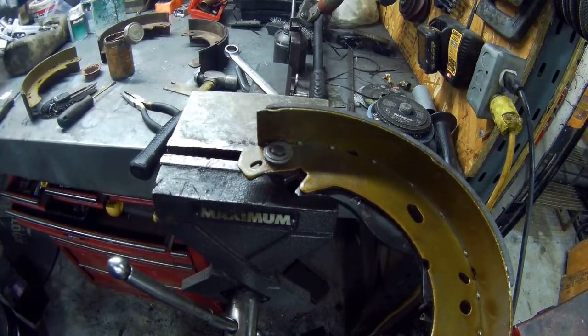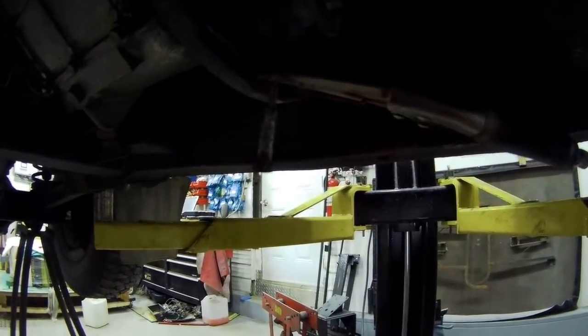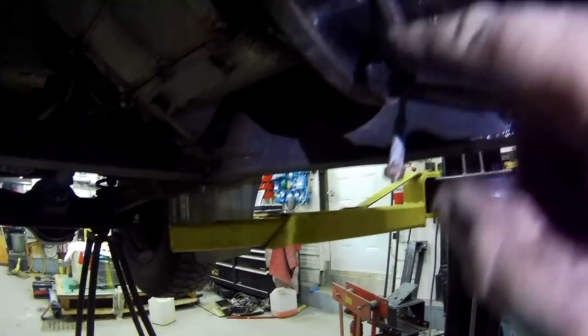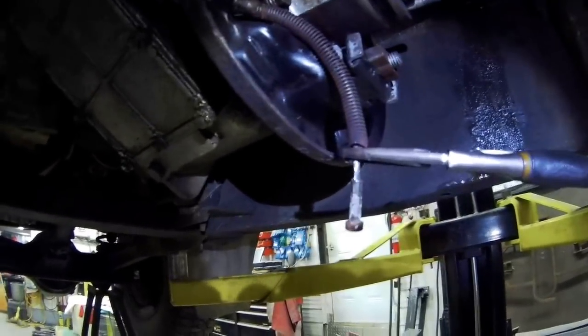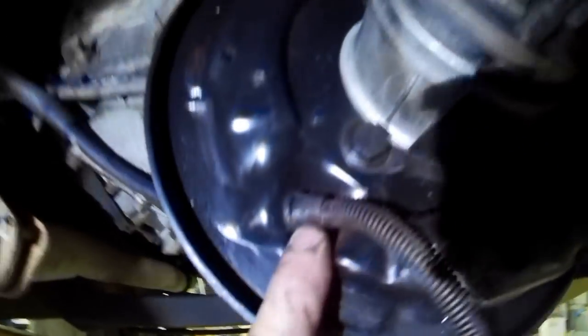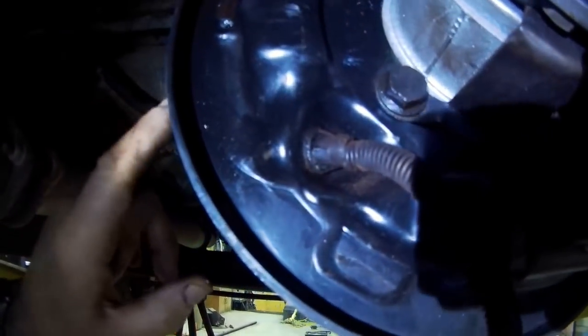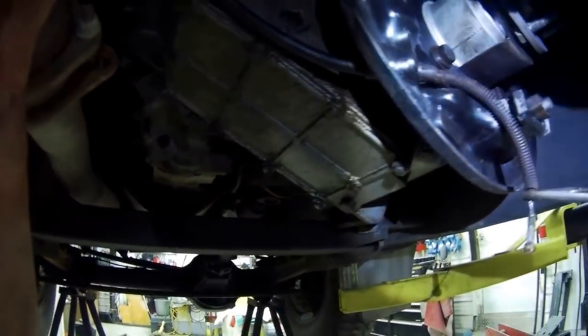Next, we've got to put it all back together again. I actually ran through the videos I'd just taken to see if they came out very well and I wasn't really happy with them, so I'm going to re-explain why I used these vice grips to push this spring up and clamp the cable. This is quite common doing handbrakes nowadays. There's a terrible little clip that holds the handbrake cable into this back plate, and it's difficult to get out. To get that clip off, you need to put a piece of tube over the clip so it will compress those little tangs so you could extract the cable.